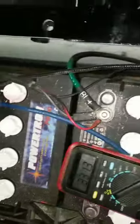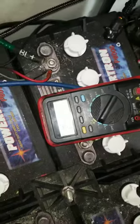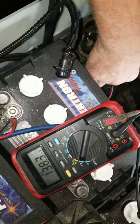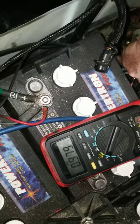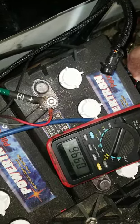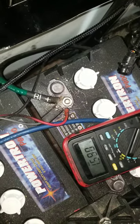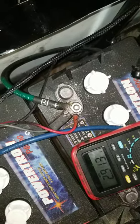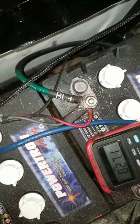Hit the gas — it's in neutral, hold it. Make sure you put the car in neutral with the key on, then hit the gas slow. See how it goes up — keep on, keep on. At full pedal you should get — actually, 2.93 volts. That's the right thing, same as with a Club Car. That's how you check your ITS.